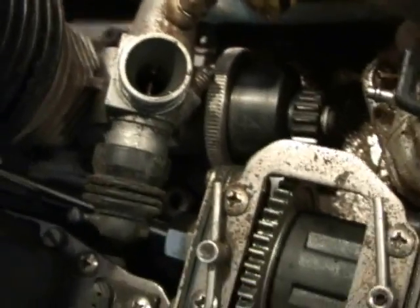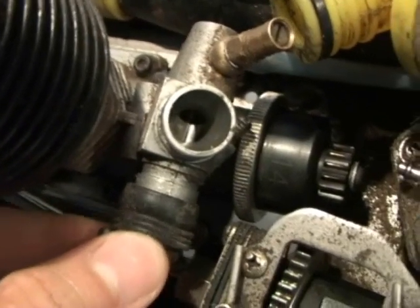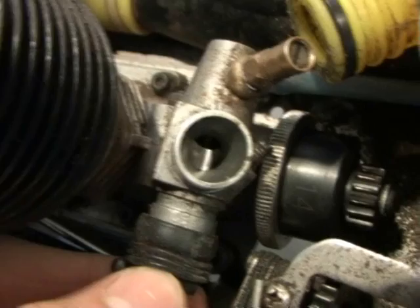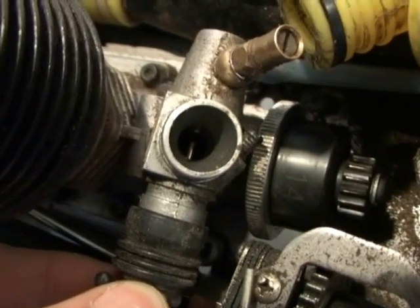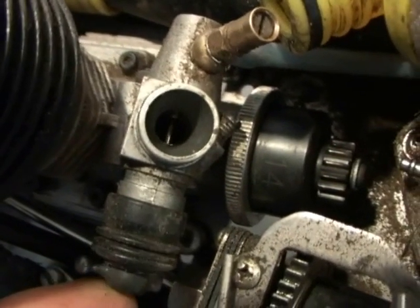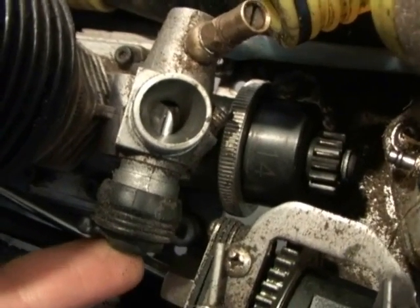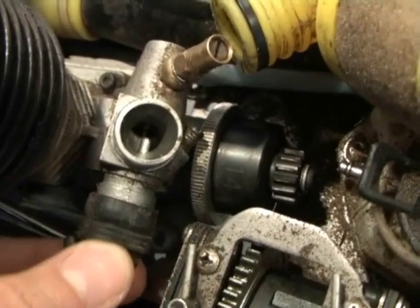If I move this, it goes in and out. When it's fully out, that's when the engine's going to its full speed — it's letting more air into the engine. As it closes, it's letting less air in. The less air you get in, the slower the nitro engine will go; the more you get in, the faster it's going to go. That's basically the speed control.